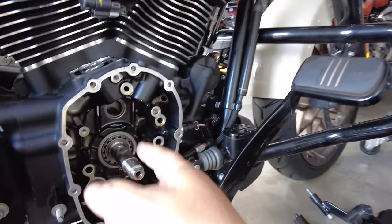Here's the new bearing - it's an American-made bearing. Even though it says Koyo, it is made in the USA. You can see the number of needles - that's the difference. The stock bearing will have fewer needles in the bearing itself. So it's just not going to be as good as this one going in. These are directional - the markings go out, the more round side goes in. You'll also need assembly lube to coat that bearing real good before you drive it in.